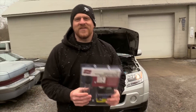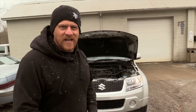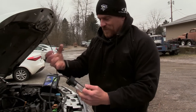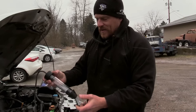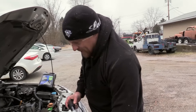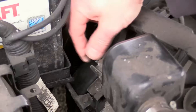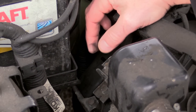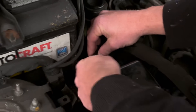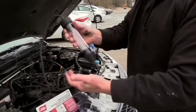A little learning curve here on this kit — it's different than the one I have. The first thing we're doing today is this head gasket check. This kit doesn't have the little ball that you squeeze to pull in air. What you do is connect it to a vacuum source. I just got a vacuum line down here that goes right to my intake manifold, and we're going to connect that to there.